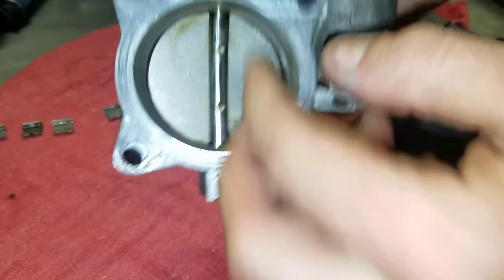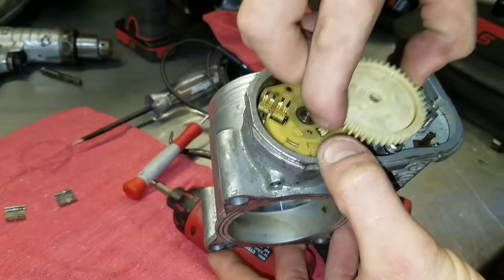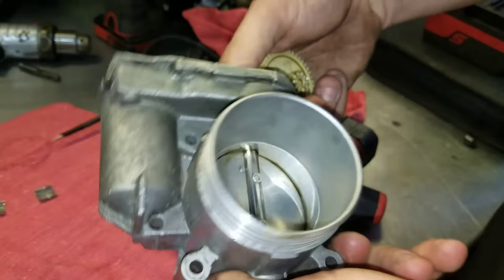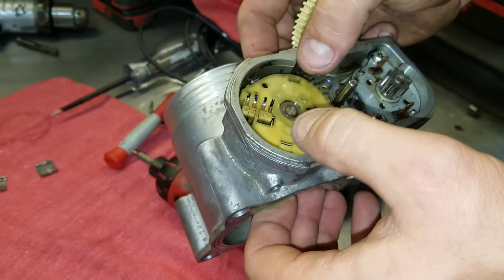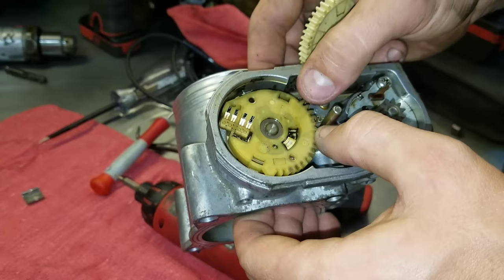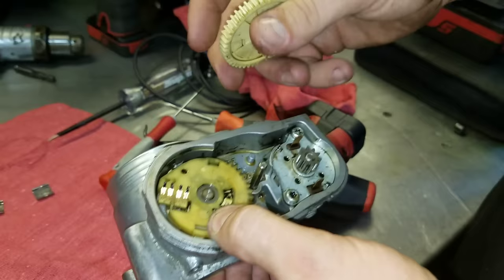Those are the big common problems with these. That's the electronic throttle body in a nutshell — not too complicated. There's really not much more to these from manufacturer to manufacturer. Most companies source their products from two or three manufacturers. This is a Bosch throttle body for the Volvos — Bosch also makes throttle bodies for GM and a bunch of other companies. So you're still going to see the same problems even if you change manufacturers. Thanks for watching. Check out the rest of my videos, post any questions or comments, and I'll keep doing these 101s. Subscribe and I'll keep posting videos.